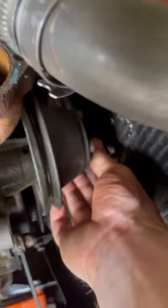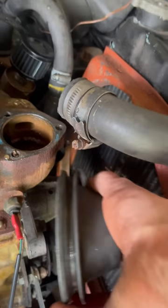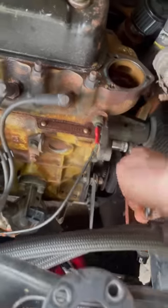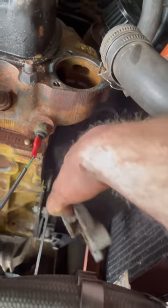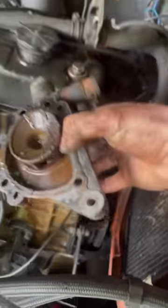It turned out that the water was coming from the water pump. There must have been a seal that was broken, so we're going to take it off first. We're going to get the bolts out. It hasn't got a fan on this because it's got an electric fan that Matt put in. We're going to get this one off — it might not have been replaced for its whole lifetime because it is pretty gammy and grimy, as you can see.